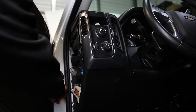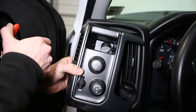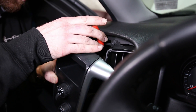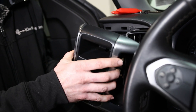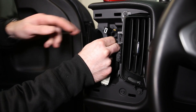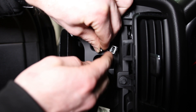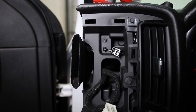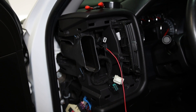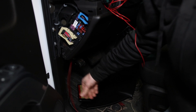If you watched our previous video, you know we fed the wire through this side grommet and into the engine bay. With power disconnected from our switch we're going to cut it so we can replace it with our new three-way switch. That wire barely reached this area so there's not a lot of room to work with. We're going to disconnect the three electrical connections on the back. Because the wire is so short, we're going to put some extensions onto it — pull it back down underneath so we have room to solder extensions on, then connect our new three-way switch to it.